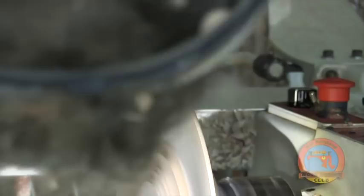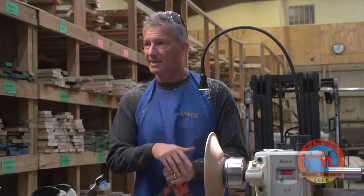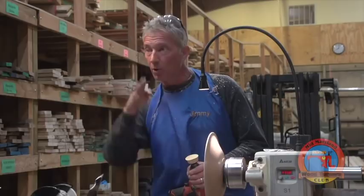240, 320. Do not cut that little radius on the edge with the tool — you'll get it digging and take a chunk out of the rim. Sand it flat on the face and flat on the side, just radiusing it in with the sanding. That was 180; we're back to the front — 320 and 400. That surface has got to be flawless. If there are any scratches from your first sand that you don't get rid of with subsequent sands, when you put the color on, the color will draw to that scratch and look like a tram line.